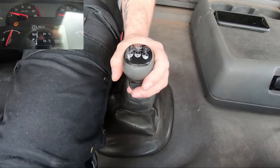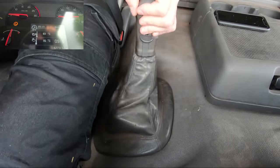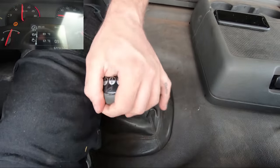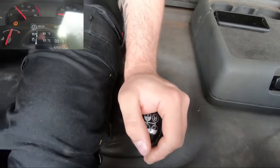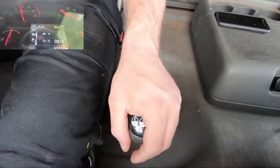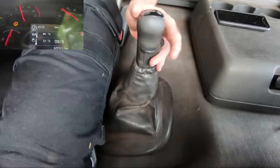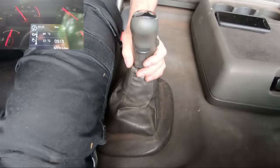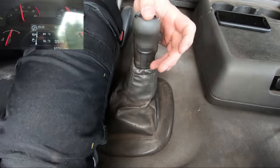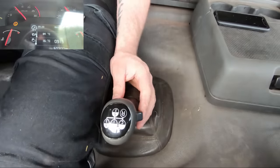Right, we'll start again — we've got a decent run here now. We're in low, setting off in second. 1500 revs into third, click it up, double clutch into fourth, then we'll use the splitter. Change at 1400 because we're empty — dump the clutch and get ready for fifth. Up to 1400, dump the clutch, get that ready — down and ready for sixth at 1400 — then we're ready for top gear when we need it.